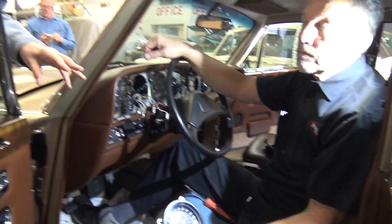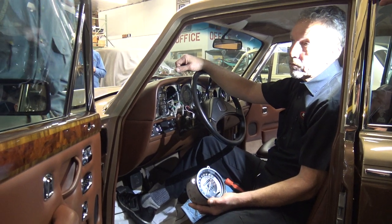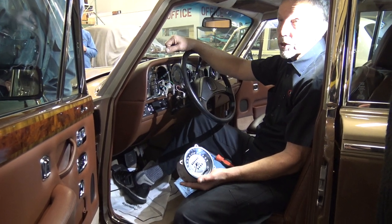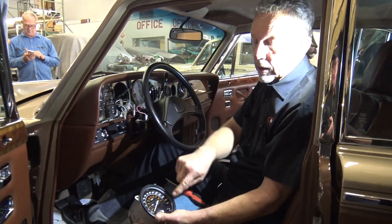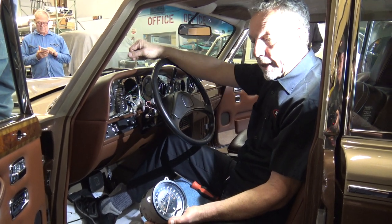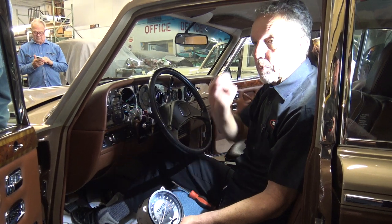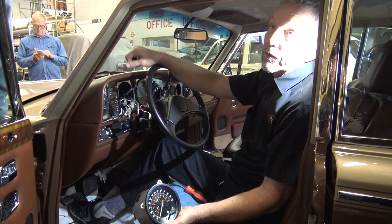What about the mechanical speedometers, like on a shaft drive off the engine — who can restore those? Typically any instrument shop or speedometer shop can restore those also. This was just a question about the electronic speedometer, and the odometer is a very common problem to fail on these. A lot of times with mechanical speedos, you'll have a cable break, you'll have a gear at the transmission break, or they have little stamped metal gears that turn all these numbers in here, and they will fail.